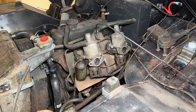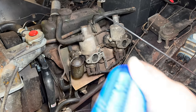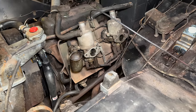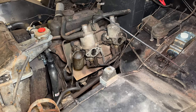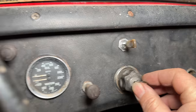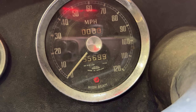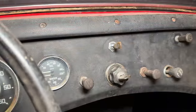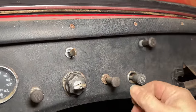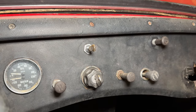Because this car has a mechanical fuel pump and I don't actually want the engine to run for a long period of time, I'm just going to give it a little shot of starter fluid. That way we can hear if the ignition fires off — that's all I want to test, just make sure we're getting power to the ignition and it's working correctly. Ignition is on; the high beam light is working as an ignition light. Then I'll pull the starter cable. Looks like our ignition switch does work.